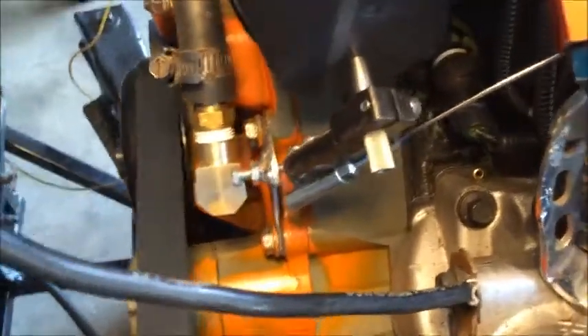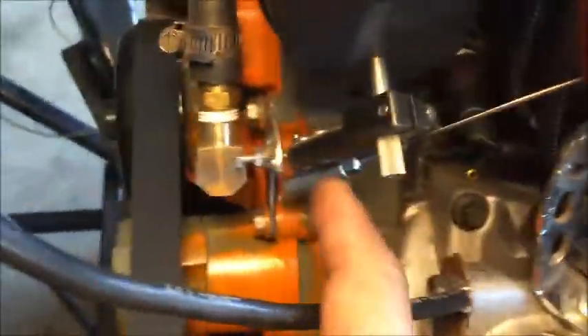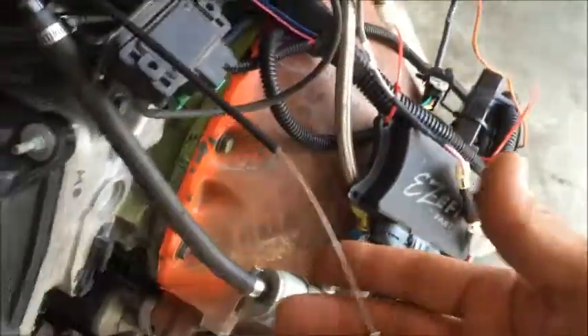I want to show the update on my throttle body — I had to hook it up to my gas pedal. As I said before, drive-by-wire throttles have a hesitation issue, plus you need the factory computers. So I bought a universal throttle cable kit off eBay. I just needed one with a longer cable to reach my gas pedal. I'm not sure if this is going to be long enough until I actually fit it in the car, but I can always put a different sleeve on it.